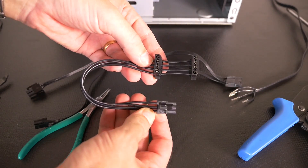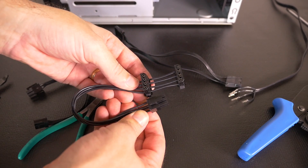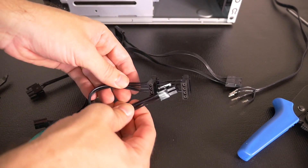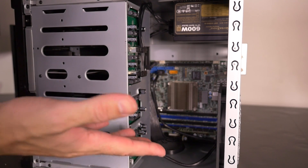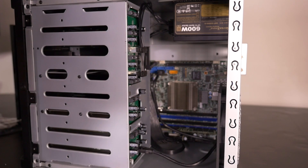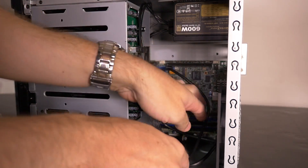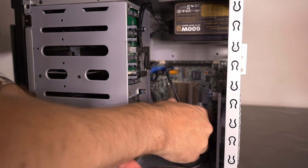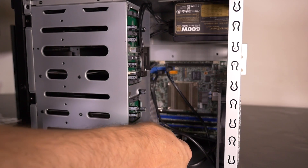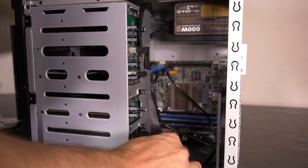I'm not sleeving it until I come back to do the upgrades. I checked the manual and found that with only one DIMM populated, memory has to be installed in the furthest slot away from the CPU — which is kind of weird, but you can't make assumptions because the system often won't boot unless the correct memory slots are populated. The SATA data cables I have are not the ones I'd like to use — I don't have the correct lengths in stock. I'll definitely change or sleeve the SATA data cables and get some that are the right length, because these are terrible.